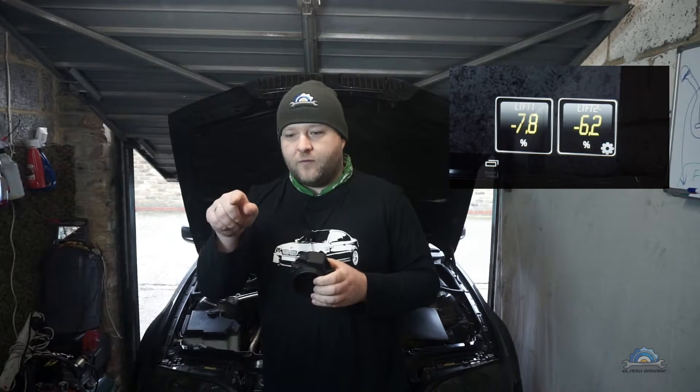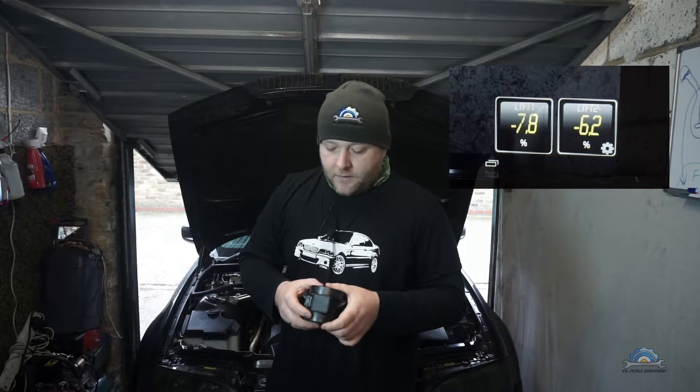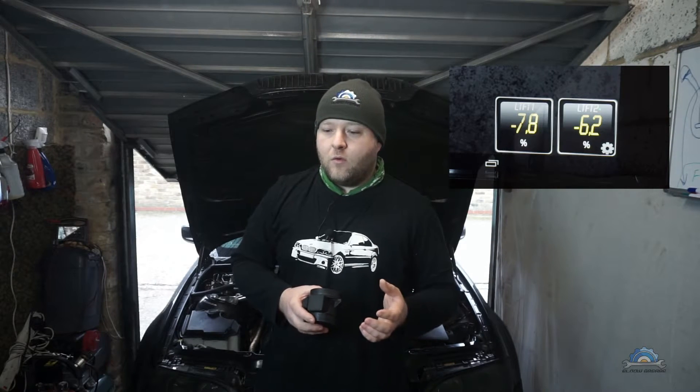The story is you're replacing most of the parts or checking them, like I did. The engine was rebuilt — there was no way to get negative fuel trims like these. I was actually swapping the MAF with a second one I had from this engine, the same one from an M52 TU 2.5, and the fuel trims were still low on both banks. I was scratching my head about what was causing that.